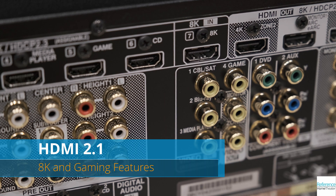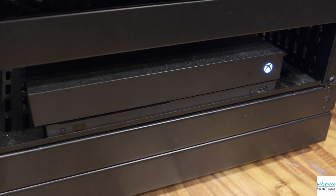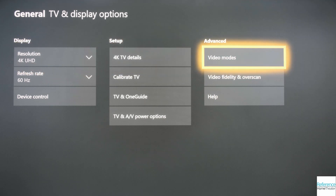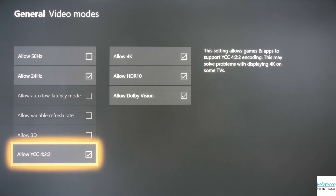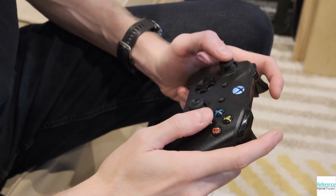There is a single 8K HDMI input on the 6700H, with a maximum bandwidth of 40 Gbps. This isn't the full 48 Gbps that HDMI 2.1 can carry, but that only matters for 120Hz 12-bit content that's unlikely to be used anytime soon. For gamers, the Denon 6700H supports all the features you'll want in a receiver, as long as your TV also supports them. It will do automatic low latency mode to automatically engage game mode on the TV with a supported console. It can handle variable refresh rates, and even supports quick frame transport, which can further reduce display latency. Most current consoles don't support all of these, but with the forthcoming PlayStation 5 and Xbox Series X, you should support 8K and all of these advanced features, so the Denon 6700H is well prepared for the future in gaming.